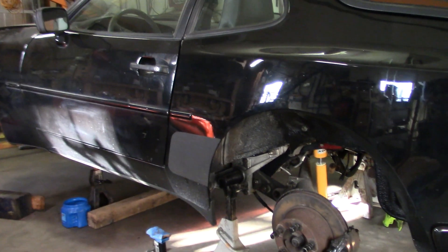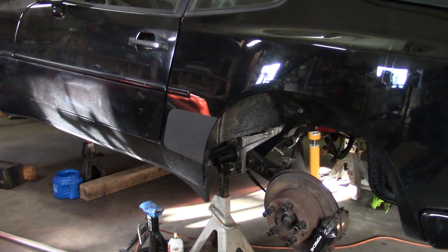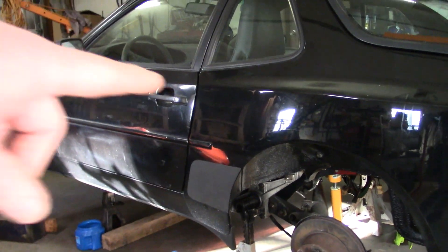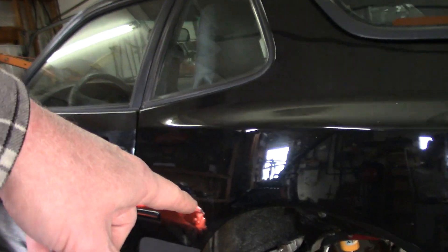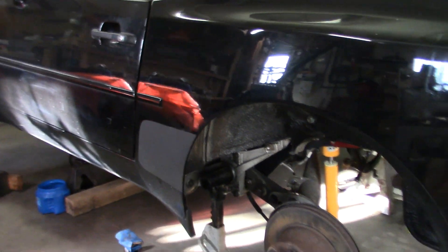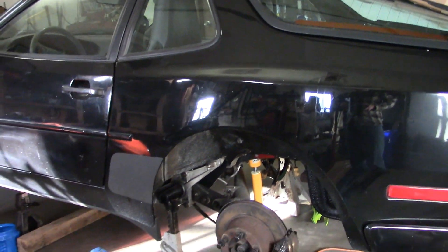You can get different heights in the back of the car. And other than the eccentric adjustment here to adjust the ride height, indexing the splines is the way you do it. That's how you do it on a 911 too.